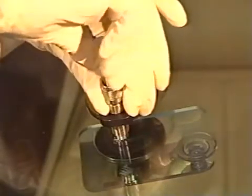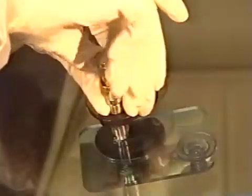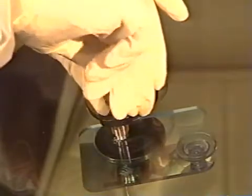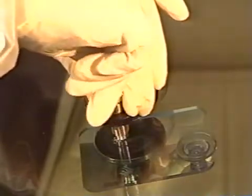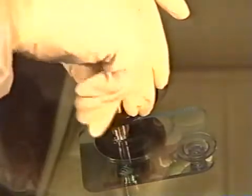While holding the injector base with one hand, screw the injector press down until you feel it tighten, then back off 3 or 4 turns. Then screw it back down again, repeating this process 2 to 4 times to create a vacuum. Different temperatures and different types of breaks require different pressures. Practice here is vital. Too much pressure can cause a daisy appearance in the repair area or crack the windshield.